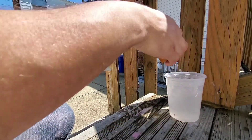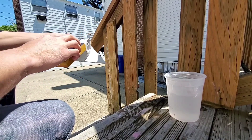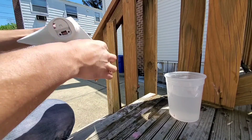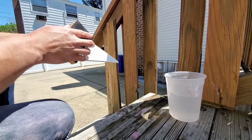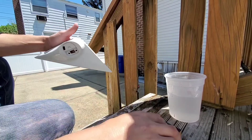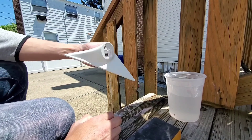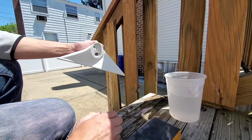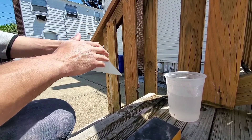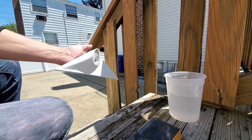Once I do that, I go over the same thing gently with the 1500, letting the sandpaper do the work. I'm not putting any pressure on it because I don't want to end up sanding too much and strip the primer off. Then once I've done both, I'm going to rinse it off, clean it to get any grease or residue from the paint I just sanded, rinse that all off, and then let it dry.